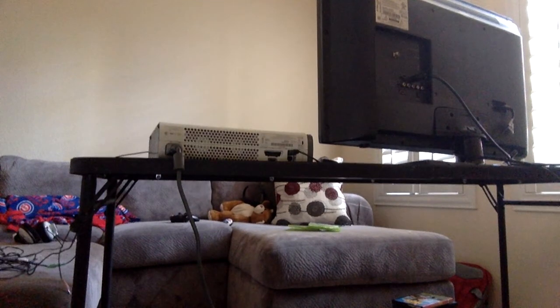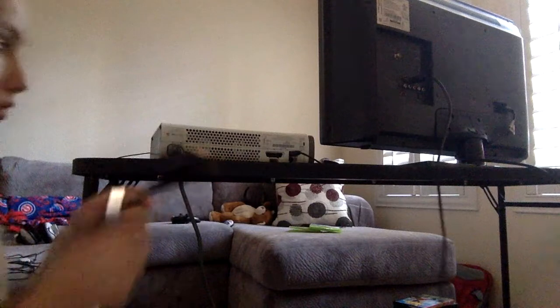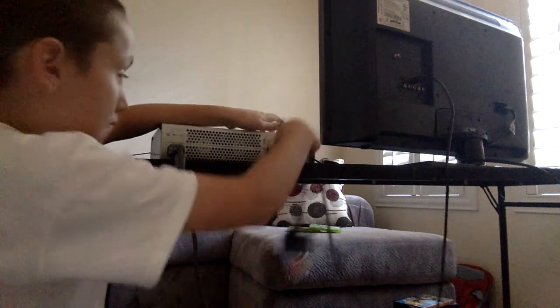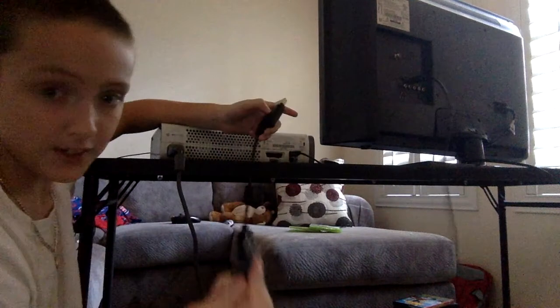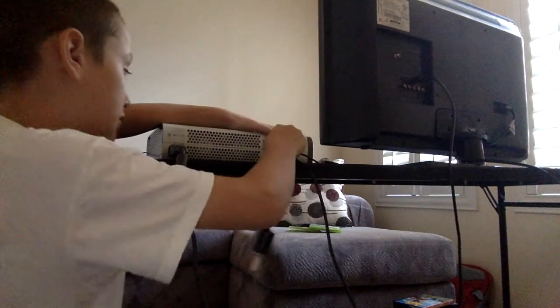Grab your adapter that you just plugged in. You're going to need your HDMI for this. Plug it into your TV and leave the other end out for a second, just put it on a chair for now. Then grab this adapter. If you plug this in first to the back of your Xbox, you're going to see this thing where my thumb is — but don't do that, because you can't do that first. You have to do the HDMI first. That's the key. It will fit — just plug it in.